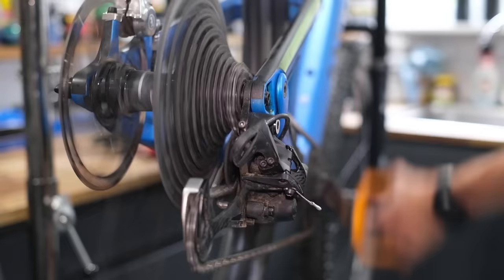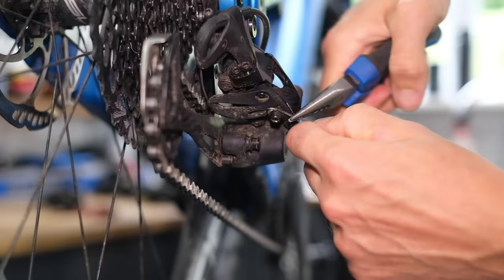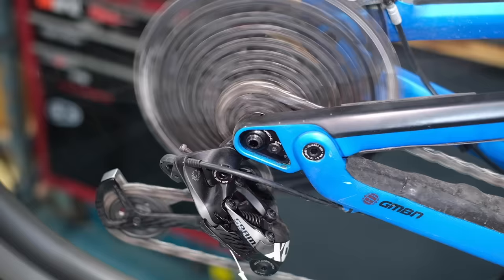Hopefully, if you've pulled the cable taut enough, you might just need to add a quarter, half, or full turn on the barrel adjuster. Make the adjustment and try again until the chain jumps up cleanly onto that sprocket, then select it so you can jump back down again. If you can get that one gear smooth, you're doing well. Next, make sure this works correctly for the first four gears or so — once you've got those four gears working smoothly up and down, it's going to work perfectly the whole way up. If your chain was over-shifting and going up too much, there was too much tension — you've pulled tight instead of taut. In that case, back to the clamp: release the cable and pull it taut, not tight. That is the key to correct shifting.